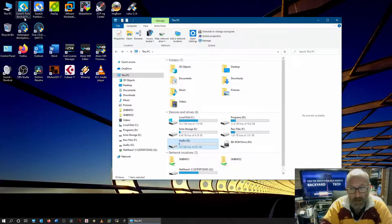I've got the BIOS set to M.2. It's a lot better having the BIOS set M.2 than having it set to auto, because - particularly if you're running a Z97 series ASUS motherboard - if you tell the BIOS that it's M.2 and set it to M.2, you're not waiting for the BIOS to try and auto-configure the drive. It's preset, the parameters are done for it, so you can just go for broke.